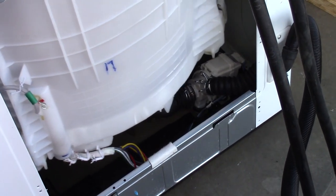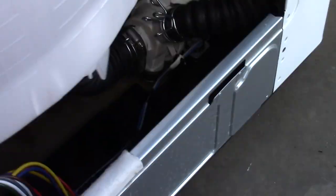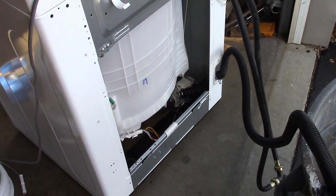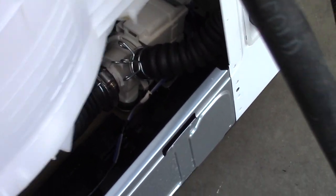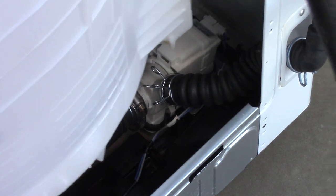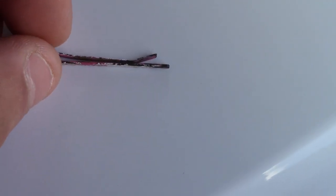The problem was the thing was not pumping and I brought it home. There's a wire down here — that blue and gray wire comes up to the side and ties in. There's a power clip here. I unplugged that and I read on the pump that it's 120 volt. So I plugged that thing in before I even plugged in the washer and the motor was not turning. So I moved on to removing one of those hoses — I think the one on the left. And when I reached in there to feel the impeller on the pump, right here's the culprit — a little bobby pin that was wedged in there.